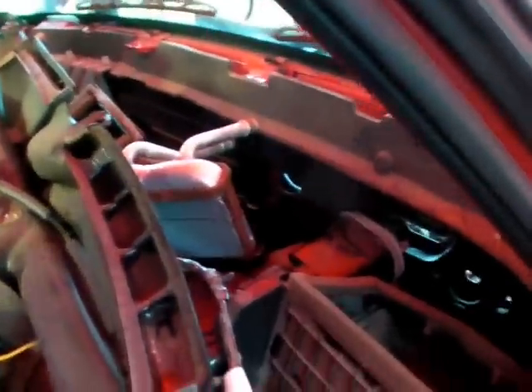In order to get enough room to get the heater core out, I can barely get those lines out from the firewall. You need to get the dashboard back as far as you can. You might have to remove the ground strap there — that might give a little bit more room too. Hopefully you don't have to remove the ductwork. I was able to get it back far enough and I'm able to get the heater core out. These pipes do bend and rotate a little bit, so you can get it out that way.